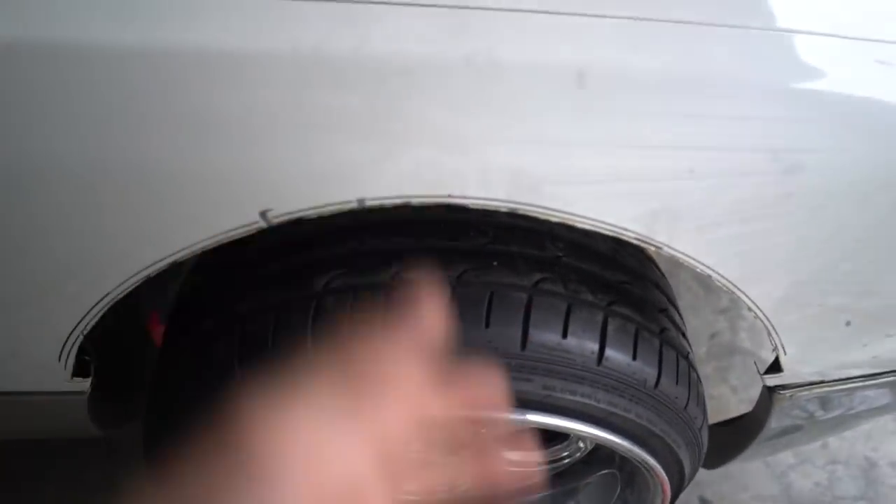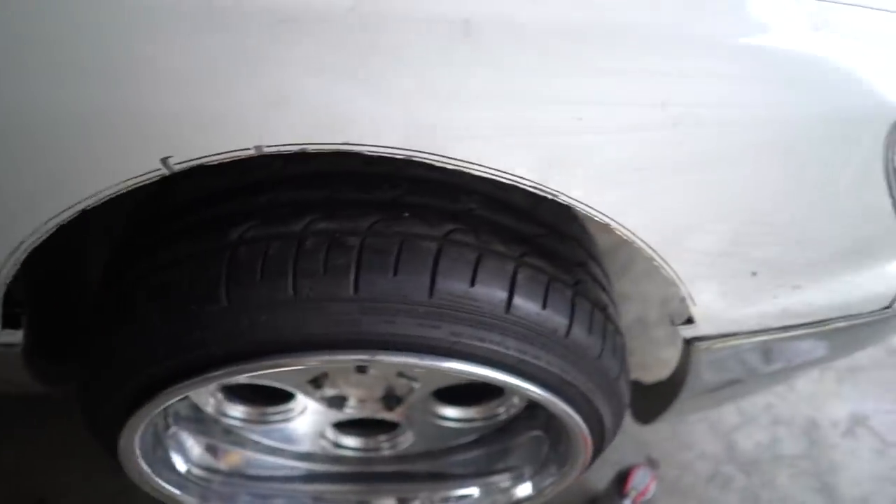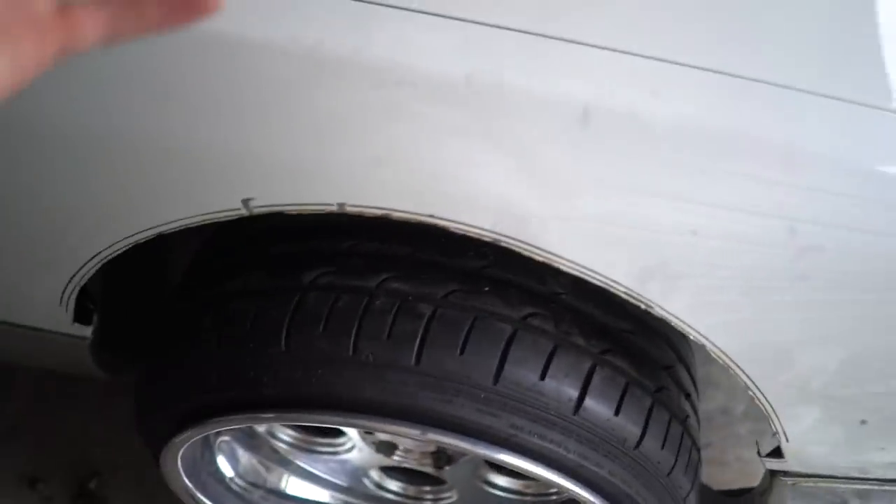Both sides are cut. I jacked them up, looked at them a million times, and it looks like they need slightly more camber — which I initially didn't expect. I thought it would be pretty much spot on, but it does look like it needs just a little more. Thankfully my homie Casey came through with some NRCAs, and that is going to give me slightly more camber, although there is a downside which we'll talk about once I get them on.